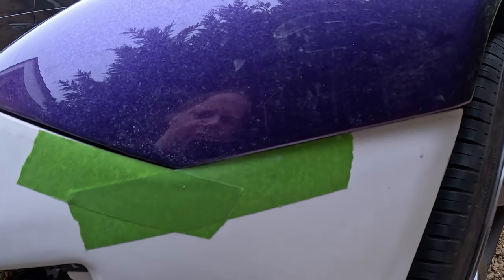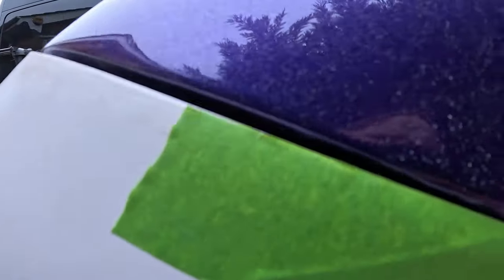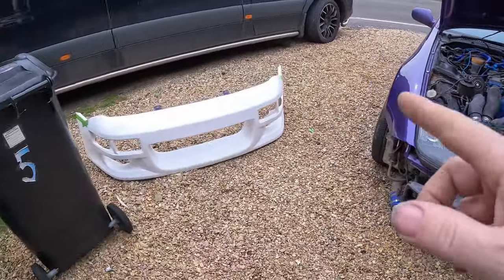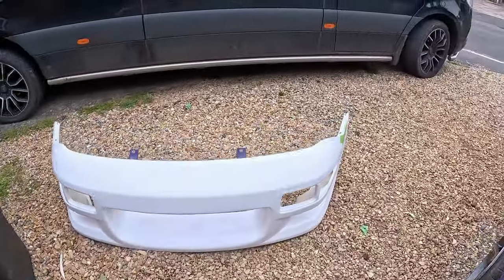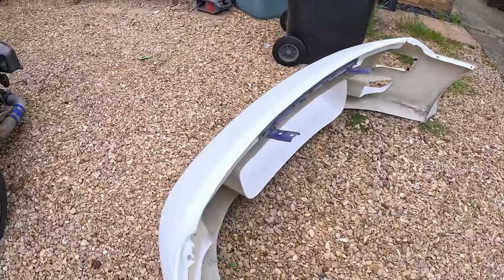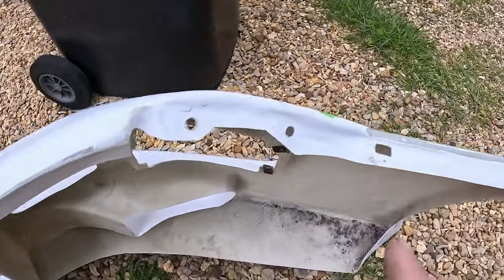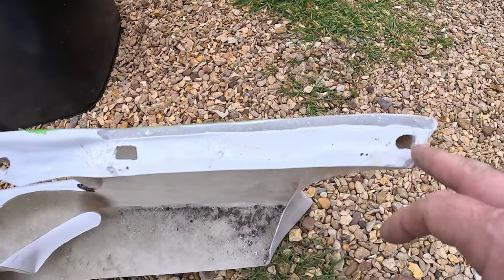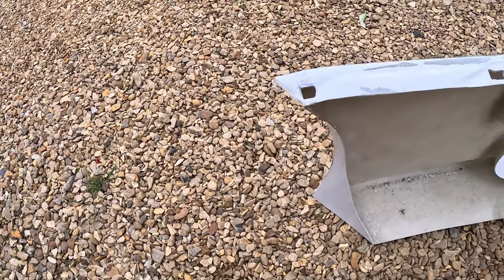So if we pull that up, found that bolt, and pull that out at the same time. This is flat this way, but I need to add a little bit in there. All the bolts out and the bumper off. Now we found the ones we lost as well inside the bumper. So now what we've got to do is put a little bit of filler in here, up this bit, and a little bit of filler in here up this bit, then offer it, sand it, offer it back up. Got to elongate this hole a little bit this direction as well, and same over here, but close.